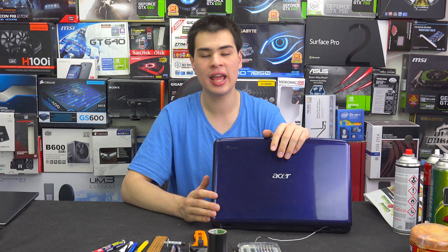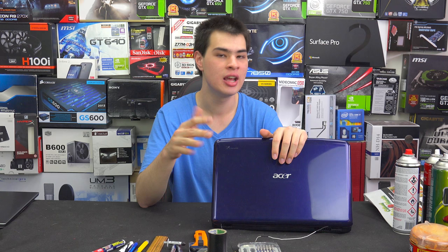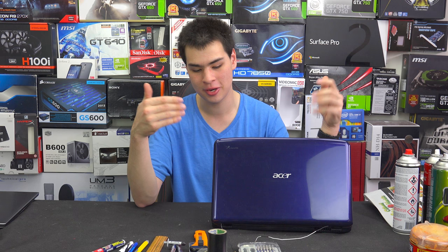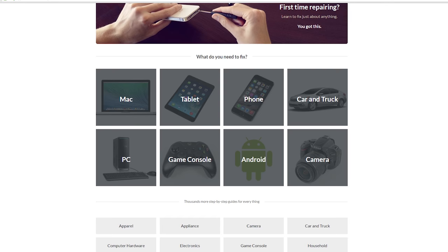Once the PC is backed up, shut down the computer and remove the battery. Then grab another device and look up a guide on how to disassemble your particular computer. If you don't have a lot of experience, try and find a step-by-step guide to remove the whole components. Once disassembled, make sure all the parts are in a special box — labelled, bagged, or a combination — so you know exactly where they go. In 3 or 4 days when the paint is cured, you'll have almost no memory of where those screws came from. iFixit has a lot of awesome guides, so start there.